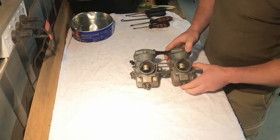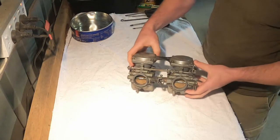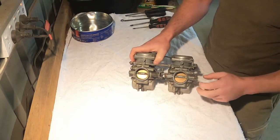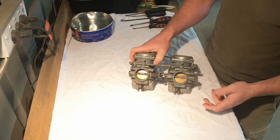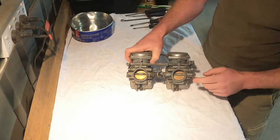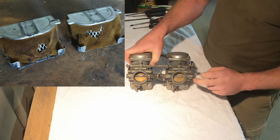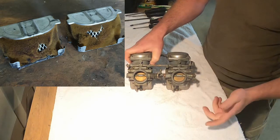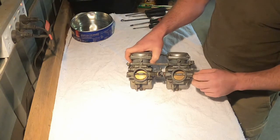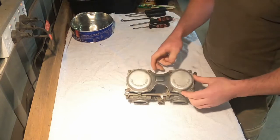Today is just another job while I'm waiting for parts, so we're going to clean up these carbs. The bloke I bought the bike off said it was running really lean and had to open the jets right up — whether he bought new jets or drilled them out I'm not sure. He thought it was running lean due to air leaks through the butterfly shafts, but looking back at the air filters I showed you, it was more likely because they were pretty much non-existent — just free-flowing with no restriction. On top of that, he also replaced the exhaust with pea shooters which flow much more freely, so that would also increase flow and lean things up even further.